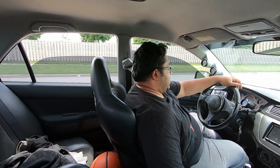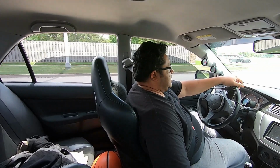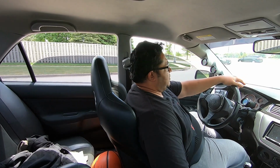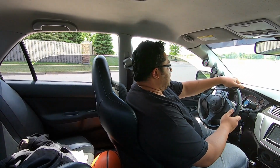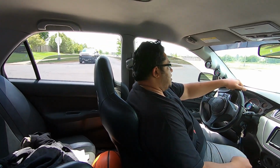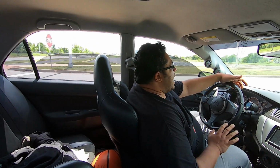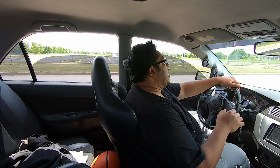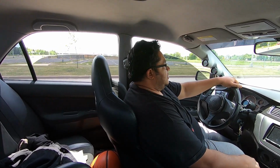Discrepancy. You know, on these, the air temperature sensor kind of has heat soak, and then when you put it on the street from the dyno, I noticed there is a difference in the fueling. So I'm gonna adjust it right now. I mean, it's not lean. It's like 12 on what, 70% ethanol, which is okay.